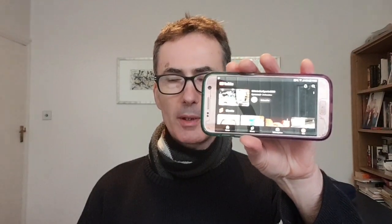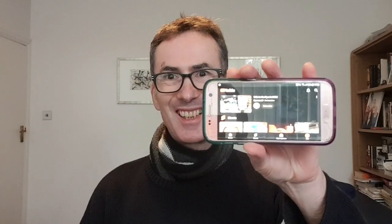Because interestingly, mobile phones have accelerometers in them, which measure effectively which way it's up, which is why, if I quickly turn the phone, it can go from landscape to portrait. Actually, that was portrait to landscape, and back again. It uses an internal accelerometer. It effectively measures the effects of gravity, so it knows which way's up.